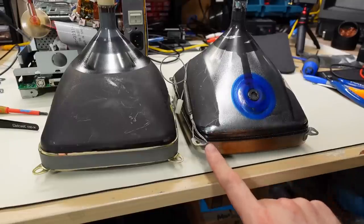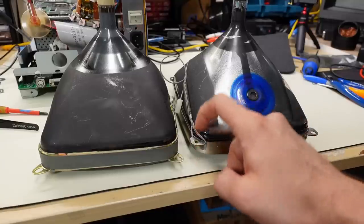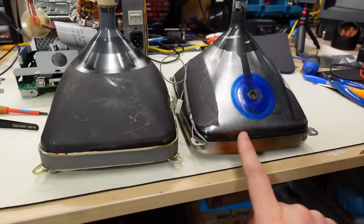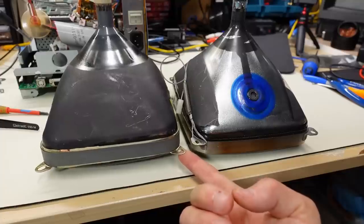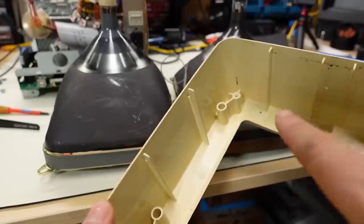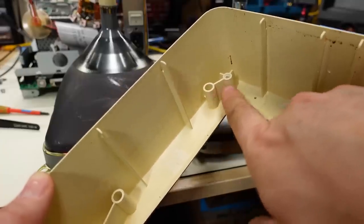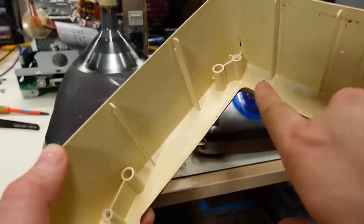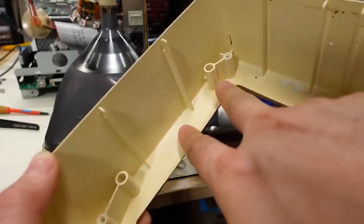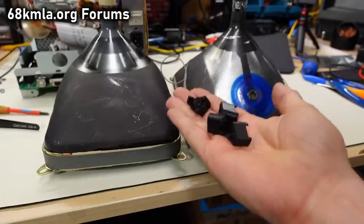Luckily, because the tabs on the green CRT are further back, we just need some adapters or spacers to take up the gap so that when I fit a screw in there, it will hold the CRT in the right spot. If it were reversed and we were trying to put the Mac CRT into the Apple IIc monitor, the CRT would be pushed back exactly that distance from the bezel with no easy fix — other than perhaps grinding down the mounting tabs by the exact correct amount. Luckily, someone on the Mac forums designed some 3D-printable spacers for this exact purpose.